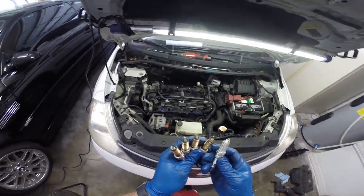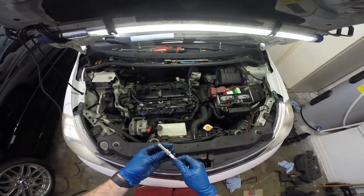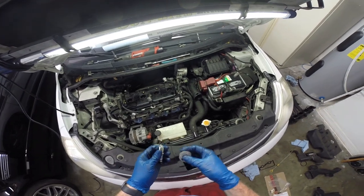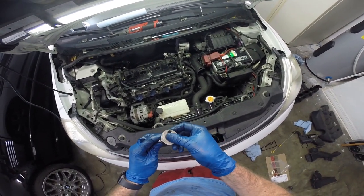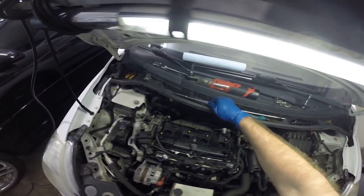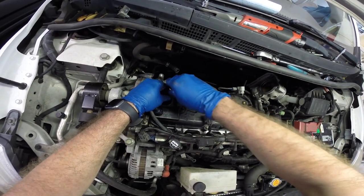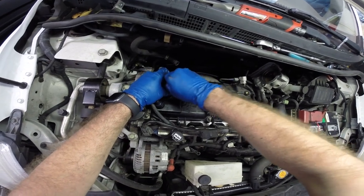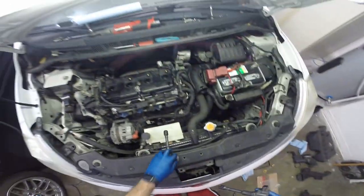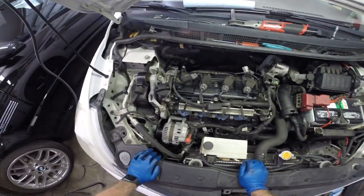These spark plugs should have been changed a while ago. I'm going back in with NGK Iridiums — nominal gap is 43 thousandths for this car, so make sure you check your gaps and adjust them. About 43 there. All these were low — they were all adjusted to about 32, just had to bend them all out. Go ahead and go in by hand, then torque them down. I'll put the ignition coils back on — I like to put them in the same positions they came off. Those are all plugged in, our harness is where it needs to be.